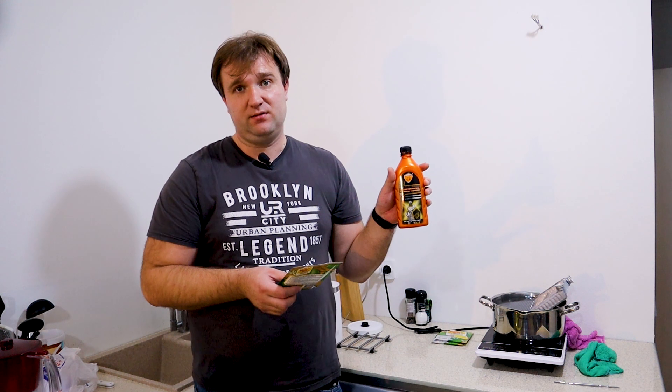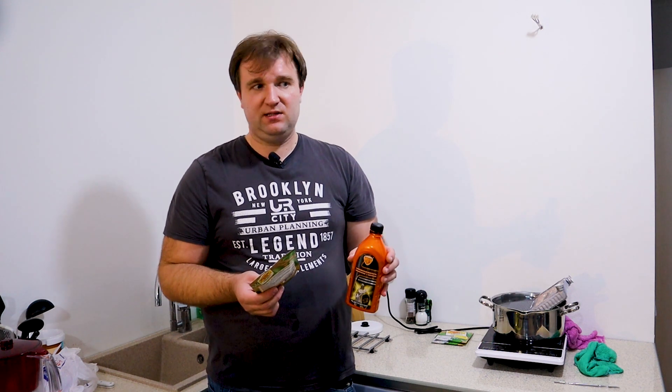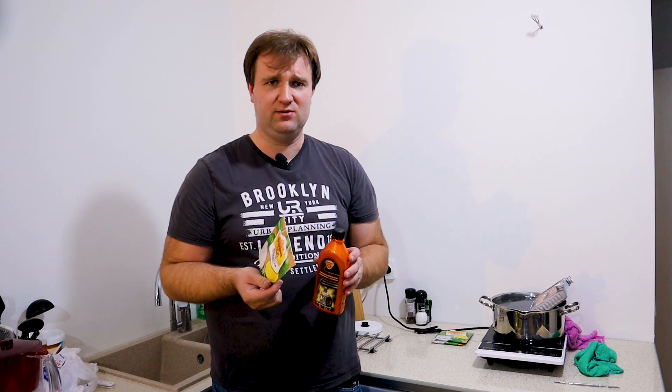Now I'm doing the last fourth control rinse. This time I'm using citric acid again — why? Simply because it's gentle. The harshest deposits have already been cleaned out by the phosphoric acid, and now the citric acid will help finish the job without damaging it. Because if you pour that whole bottle into the radiator, you won't have a radiator anymore — physically a little will remain, but it will essentially be one big hole. So use a little phosphoric, then a little citric, and one pack is enough.